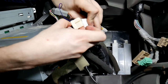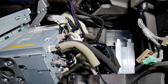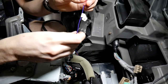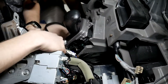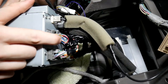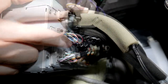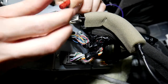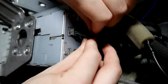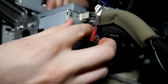Now we've got our harness here. Now that we've got those connected we have one last thing — the rev wire, which will need to be tapped. On this vehicle it's going to be on this 28-pin connector right here. We've already tested it — it's the brown wire in slot pin number 20. For this we just unscrew the bottom part and it'll go around the wire we want to tap, then put the top back on and twist. You'll feel it tighten up and that's when you know it's good.